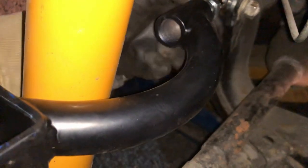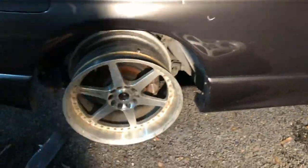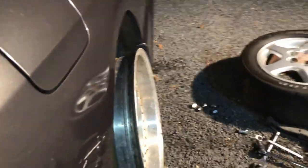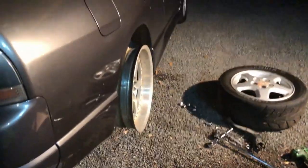Let's see what happens here — you can see the whole hub moves when I moved that a little bit. It's probably getting some toe-in a little bit. I've just popped this rim on there — that'd look sick if it was actually on there. I haven't got tyres on them right now, but I'm going to use this bit of wood to actually see how the camber is. If I look along like that I should be able to adjust some of the camber, just loosely.